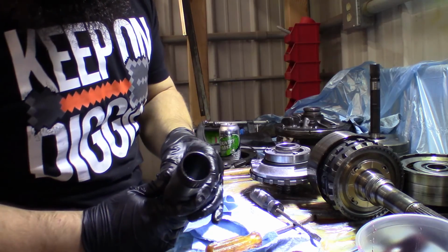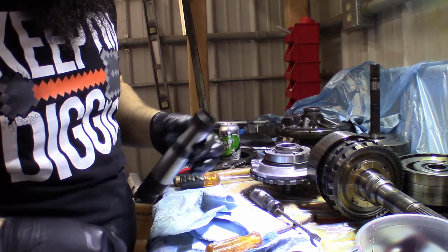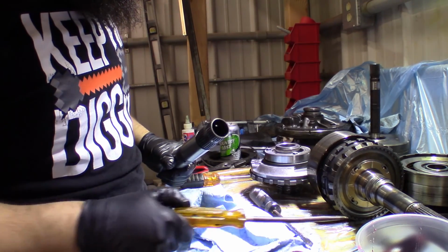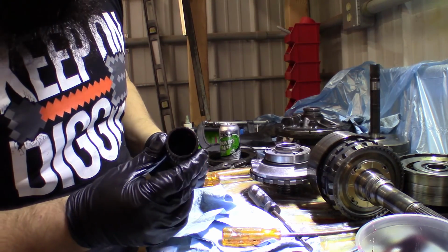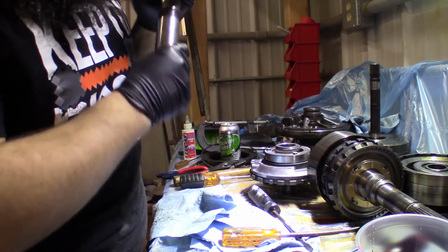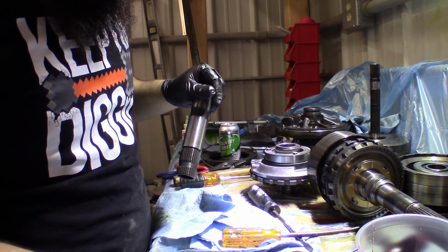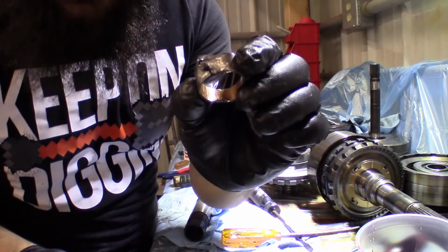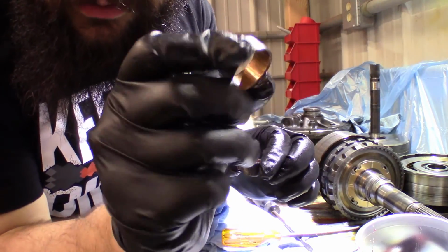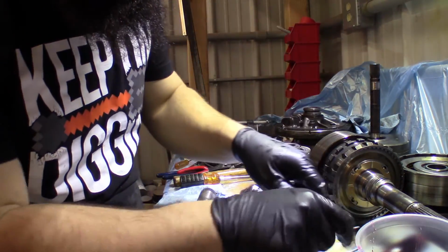Okay, the bushings in this guy really suck to get out of there. Played hell with the first one. Once I got it out, I took a 17mm deep impact socket and dropped it in there and just shook the thing and let it beat against the bottom of it until it beat the thing out. So here's the difference. Here was the first one that I got out, and here is the second one. So yeah, obviously one was easier than the other.